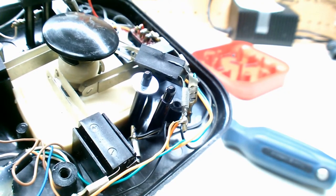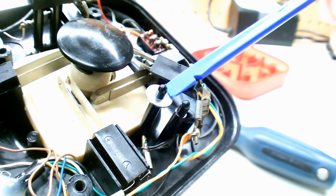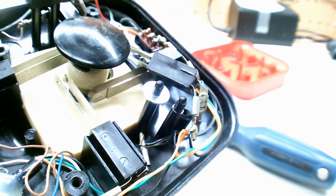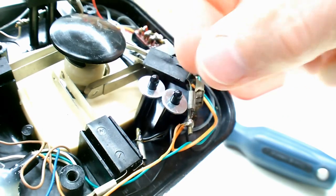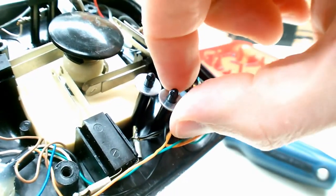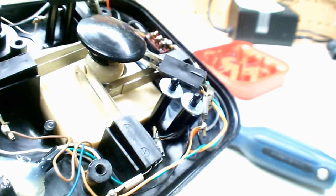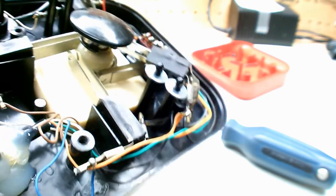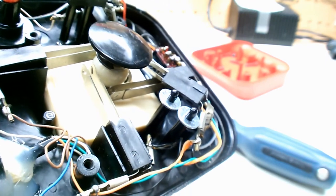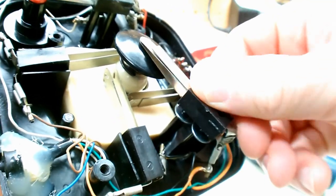Now back to the fire button switch issue. I think I've figured out what's going on. The leaf switch assembly isn't sitting properly on the mount and seems to be resting lower than its normal position. So by adding two washers, which are about 1 millimeter thick and they fit perfectly on the mount, the assembly seems to stay at the right level without dropping lower than it should. Perhaps the mounting holes have become larger over time and with use, and it was sitting too low.